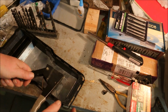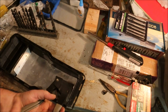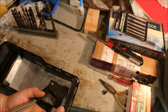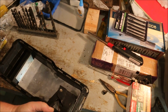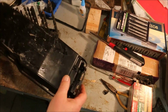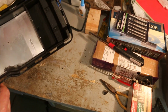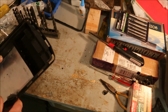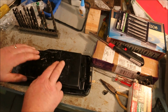Sometimes you can put them in this way too. Use the riveter as a handle to help guide them through. That's helpful when the rivet's back at a blind hole. You can't get to it very easily. There. Nice and solid. Now that wall sits down on the box below, and this one does too. So it's got a good sound support all the way through there. I shouldn't have any more trouble with that console breaking.